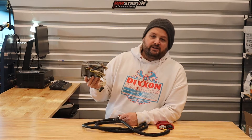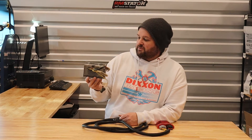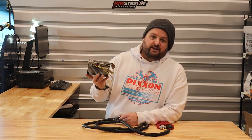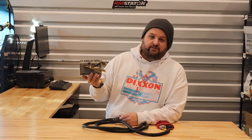That probably seemed like a great idea 20 years ago when they were making these. But the problem these have always had is the voltage regulator rectifier fails and you lose your charging system. Most of the other functions inside — the fan control, the circuit breakers — continue working fine, but the regulator fails.